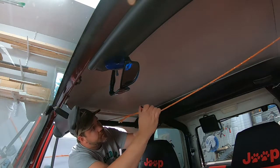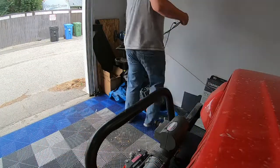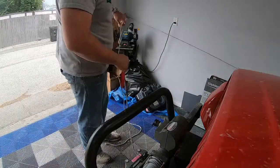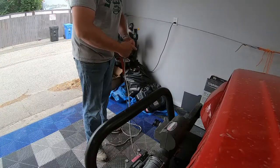At this point you do have to disconnect obviously all the screws, bolts, and connectors in the roof. Then back to the front of the vehicle — the real key to this design was using the winch that I already had on the Jeep to lift its own roof off. So here I just hook it onto the winch on the end of the rope, again through another really large gauge pulley there in the corner of the garage.